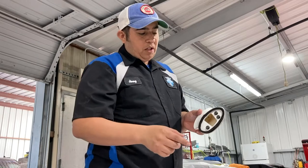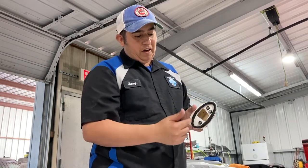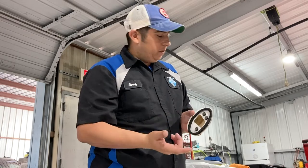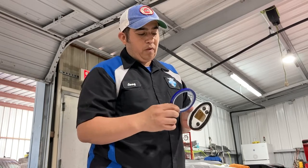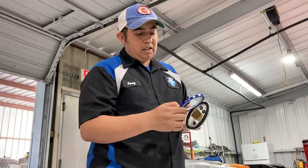If we use an orbital sander in this area, it'll probably tear the foam that's on this base. We want to mask it off to protect any damage from the orbital sander. For this, I'm going to use a 3M fine line — I'll outline it with this one and then come back over with yellow masking tape over it so that it doesn't affect the foam.